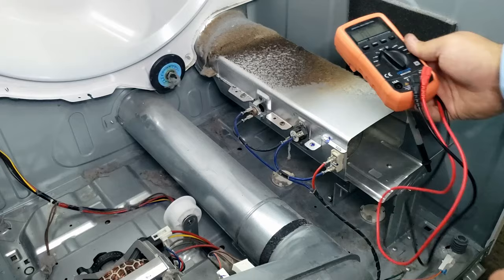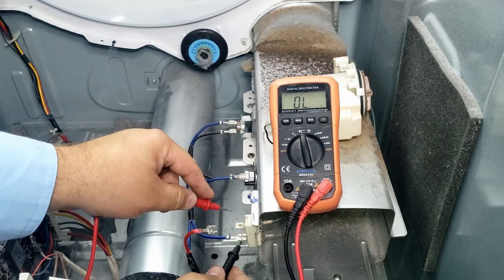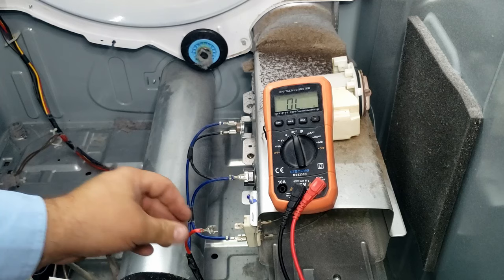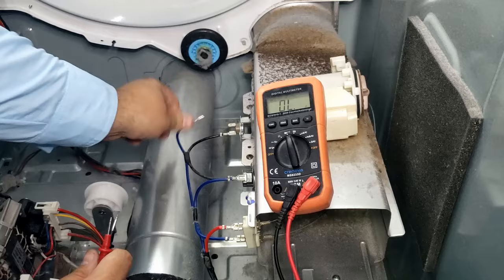To test these components, turn your multimeter on to a continuity setting or you can use an ohms resistance setting. When testing the heating element, you should get continuity and about 10 ohms of resistance if the heater is good, when you touch the multimeter to both spade terminals simultaneously. You can also check if the element is grounding out to the metal canister by putting one multimeter lead to either spade terminal and the other to the canister itself. If you get continuity or any active current, the element is grounding out to the canister, meaning the element is severed and needs replaced immediately.